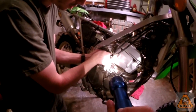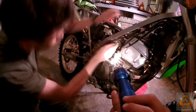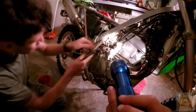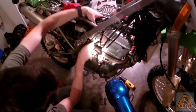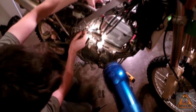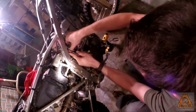There is an upgrade kit for these to go to Allen head, but I don't have that. That's three screws — we've got one more. You have to rotate it down to get that one. We're going to take it off and we might see some gas come out. There are floats in there, so you just want to be careful when you take them out so you don't mess up your floats. Remember which way it comes out because it always has to go back in the same way.